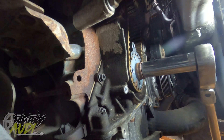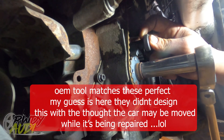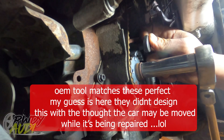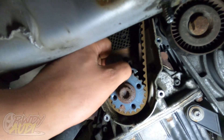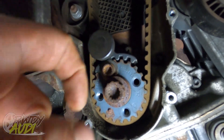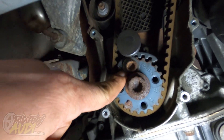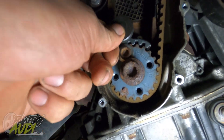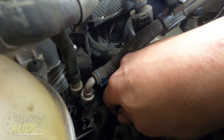That wasn't so bad. I'm a little sus that thing just came out like that, but whatever. We got the lower lock pin in. I ended up making a little washer because the lock bar just flops all over the place — put a washer behind there and one of the factory bolts to keep it in place. Up here, the kit comes with this little pin and it goes right down into the hole.